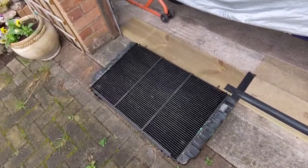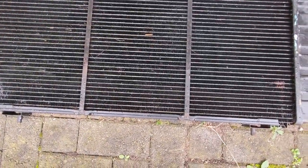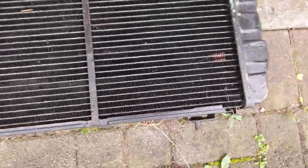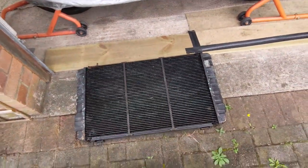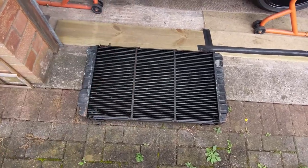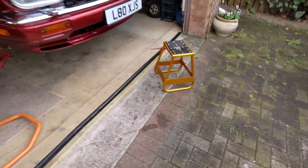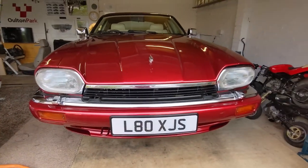That's looking pretty good. I'll get in there with some brake cleaner later on as well and see if I get even more out. When I had it up to the light I could see a bit of light through the fins, which for what I need that radiator for I'm happy with that. I also blocked off the outlets and pumped a bit of water in, holding my hands over things, and I didn't see it spraying out of anywhere — so it's fixed. We'll find out when I put it on the car.